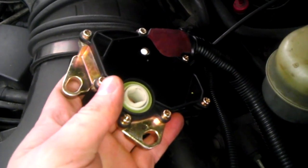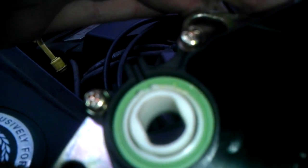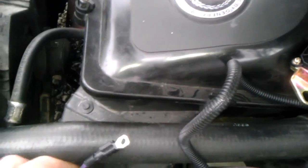I came up the circuit a bit and got the neutral safety switch out. You want to make sure your car is in neutral when you take it out and install it. There's a notch where it all lines up for neutral. I checked to make sure there's voltage coming from the ignition and the relay to the two connectors, and it had voltage, but I was only getting four volts on this end.